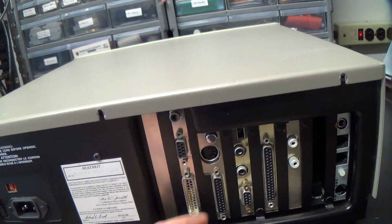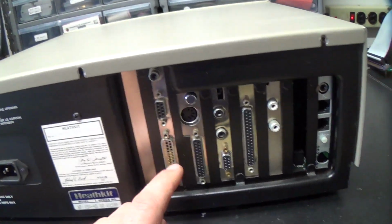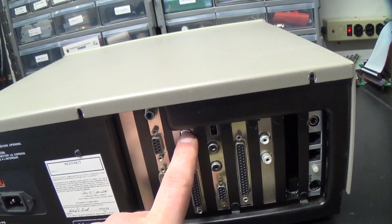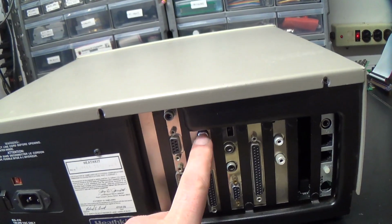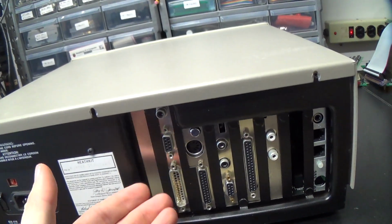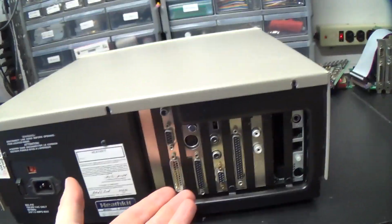That's exactly what they are. And yeah, that's a parallel port, and yeah, that is a keyboard port. I'm sorry for being a drama queen and trying to stretch things out, but yeah, this is a turbo switch. It switches it between 4.77 megahertz and 8 megahertz. All right, but why are they on what appear to be expansion cards?